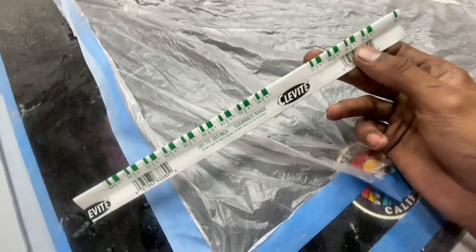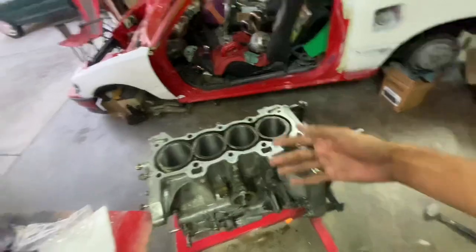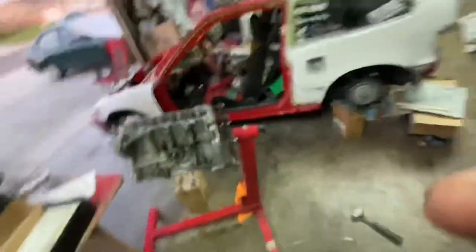Next video on the engine we're going to be doing dry assembly. I have plastigauge right here — let me know in the comments if any of you guys even know what plastigauge is. I went to AutoZone trying to pick some up and they all looked at me like what the hell, but O'Reilly's came through. The next step is: we'll put together pistons and rods, press rings in, check ring clearances, do ring gap, then flip the block upside down and start matching bearings. I just have some standard size King bearings for both the main and connecting rod bearings.